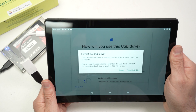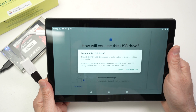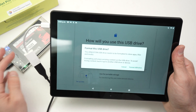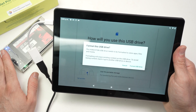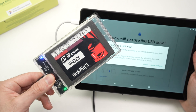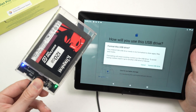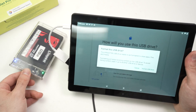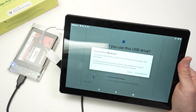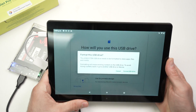If it's not compatible, it will give you a message asking you to format your USB external drive. Unfortunately, this means all the information on it will be completely deleted, which you may not want. So first make a backup of the drive, then format it, then transfer the files back onto it before connecting it to your tablet. ExFAT and FAT are the confirmed accepted formats.